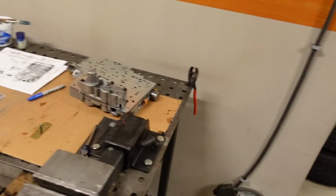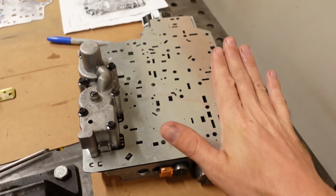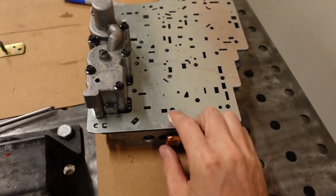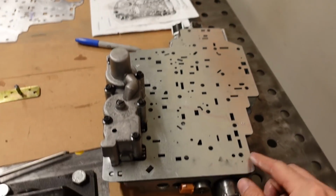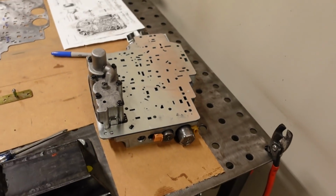holding power. Now, if you'll remember, when we rebuilt the unit a couple of videos ago, I actually left off 1 sealing ring and a lip seal in the center of the direct clutch, and that'll accomplish the same exact thing without having to use this dual or 3-layer separator plate. And the reason why I want to get rid of it is because it's known to cross leak, or basically in between these 3 layers, fluid can kind of get where it's not supposed to be.